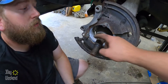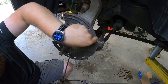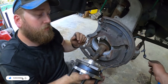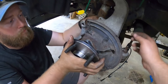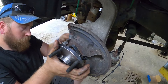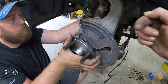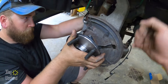We have the bolts through here to hold that shield, and now we're going to put the hub on. It's easier to run your wire first and get it out of your way. Once you've got a couple of those bolts threaded, go to the back side and alternate around so you pull it in nice and straight. Tighten one bolt, go to the next one, tighten that a little bit, tighten the next one — just keep rotating until they're all tight.